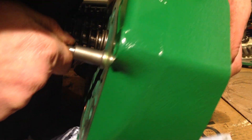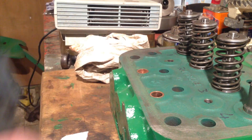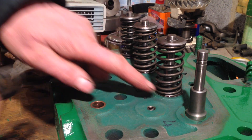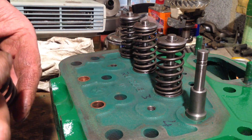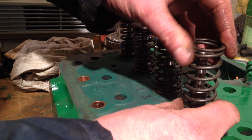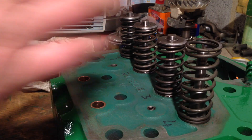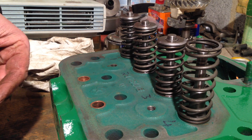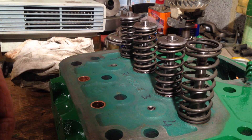Again just an old nut or something, put it on the valve like that, and then just quietly tip the head over. Stops the valve pushing through. As I say, there's no little washer on there, no valve seat washer. It might just be to hold and give the valve spring somewhere to stop it moving around, I don't know. Or maybe there should be ones on the exhaust and they've just got lost over the years - who knows.